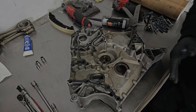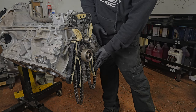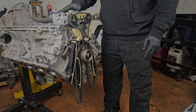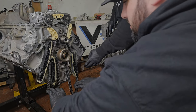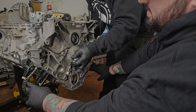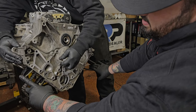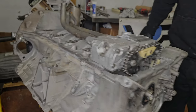Now we're going to move this over to the engine. The chains and guides are on, guides are lubricated with our Liquid Moly assembly paste. I went ahead and replaced the seal for the oil pump and the pickup tube O-ring. Sometimes these parts are hard to get - do not risk it. If these parts fail, you're going to be in big trouble, so make sure those are new. I'll hold the chains so that this area remains accessible for the timing cover, and that's completely sealed - you can see right there where it's pressed up against the block.